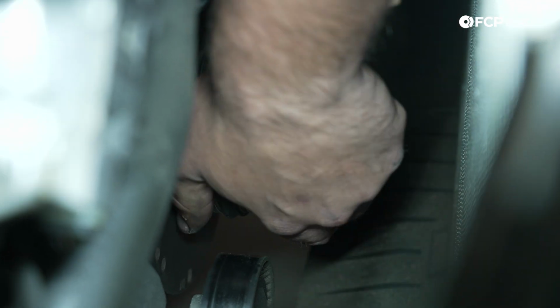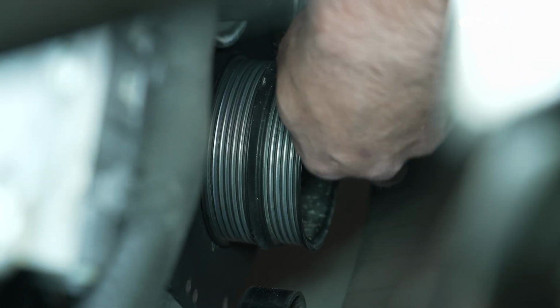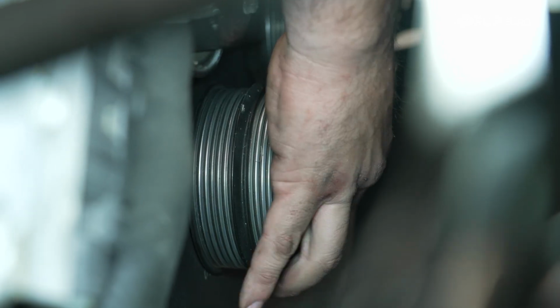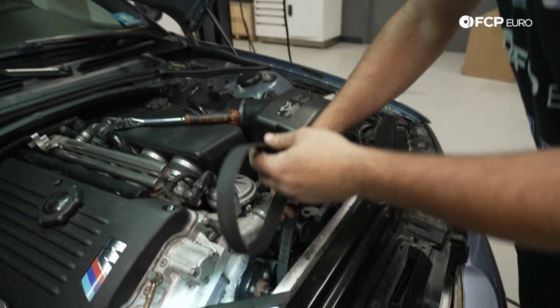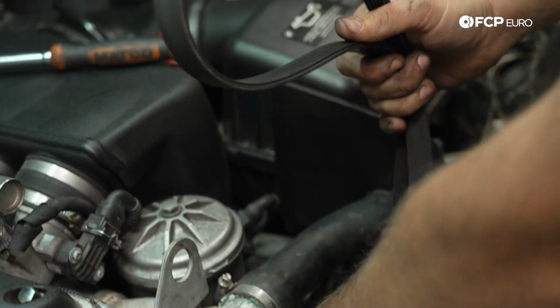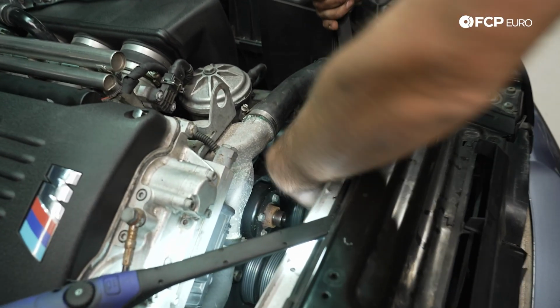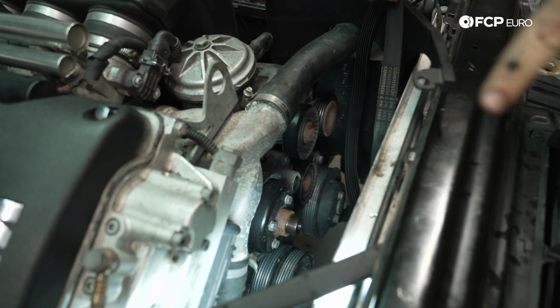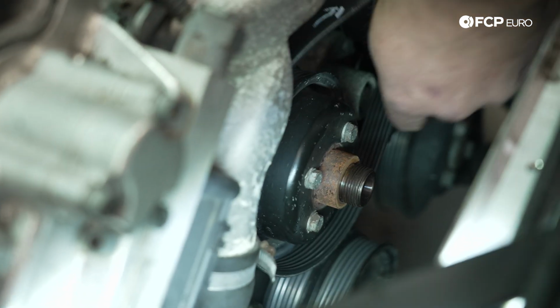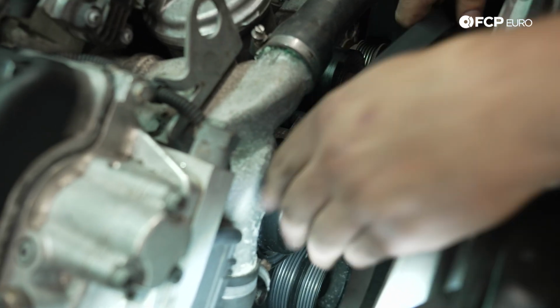I know you can't see anything on camera, but we do have a view of what it looked like when it came apart, so I'll show you that again. Six 13mm screws we need to put back in, just line them up, and then we'll torque them down. So now we're gonna go ahead and reinstall our belt. Rotation is this way, hence the arrow. Yes, that idler pulley is noisy. Yes, that tensioner pulley is noisy, but we have a full video on how to replace those parts. So if you are interested in doing so, now's the time.